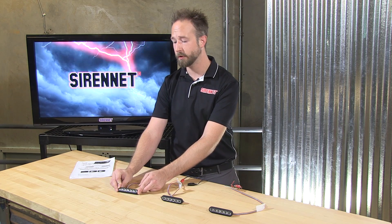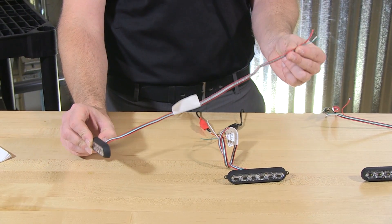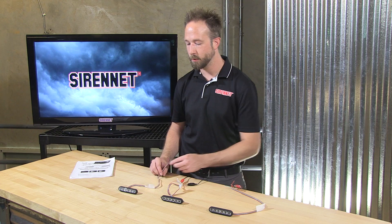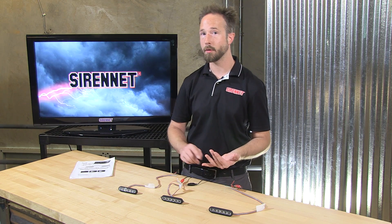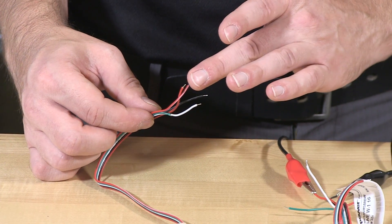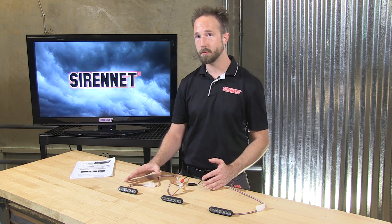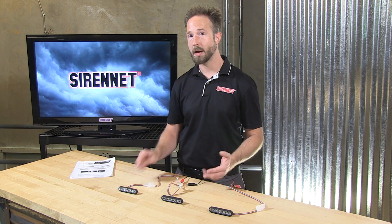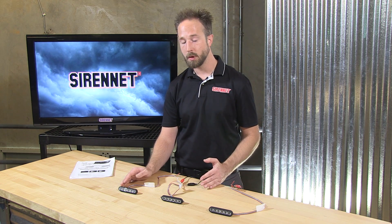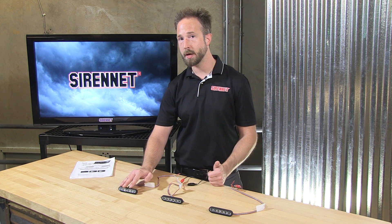As you can see with these light heads, there is a lengthy pigtail to get your installation started, and there is a total of five trigger wires. You have the ability to tie them into your SoundOff or other manufacturers' siren and lighting controller, and you can do lead ground tie-in for general voltage. There is a flash pattern change wire. These are available in different color configurations: a 6-diode single color, 12-diode dual color, and 18-diode tricolor. Flash patterns vary — in the single and duals, a total of 12 patterns; in the tricolor, a total of 14.